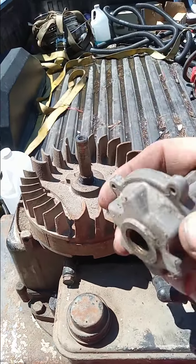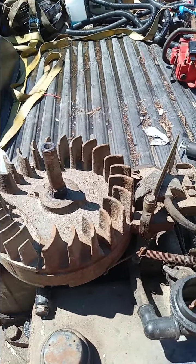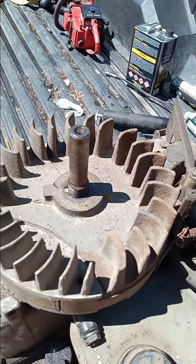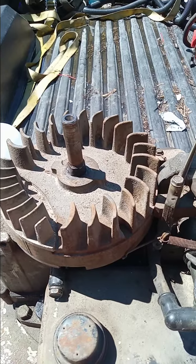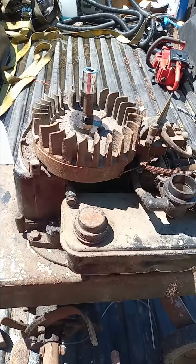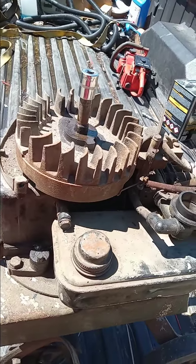You can hear the ball bearings in there. Before we put it back together, I'll show you guys how to lube that. And then we're down to our flywheel. And there's our flywheel key. So let me see if I can't get that flywheel off of there. I got the flywheel broke loose, but I wanted to show you guys how I did that, because a lot of people think you need a big, expensive puller.